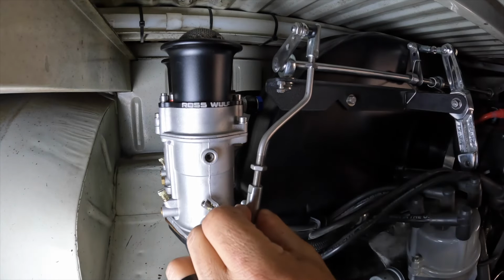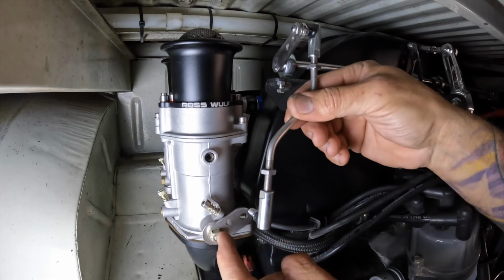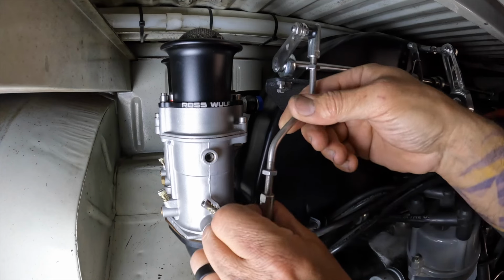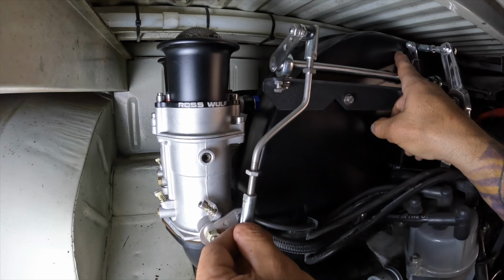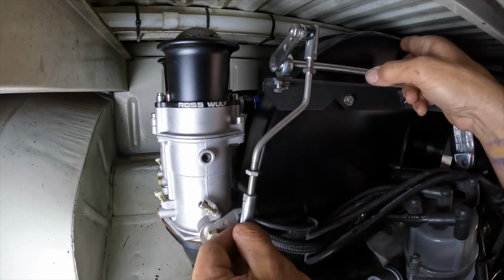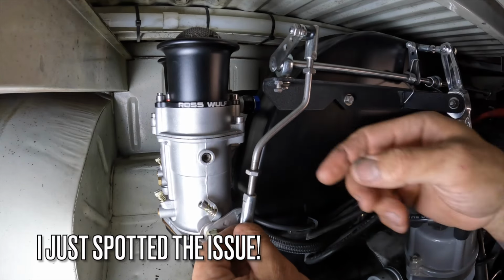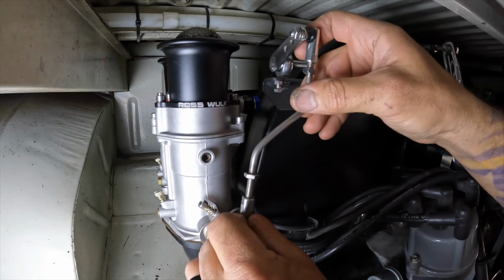So I can already see there that I'm not reaching the carburetor. We're going to go one more turn out on the top. And we got a couple that we can do out here. One, two, three. And also keep in mind, when we get this set, this space here, we actually want an air gap there. We don't want that always touching the fan shroud. It should be spaced away from it. And that way, when it goes to return, it's actually returning. It's pulling up on it.